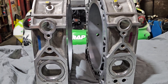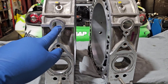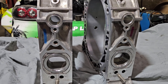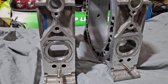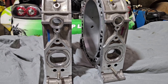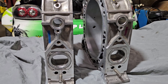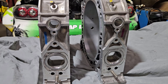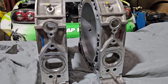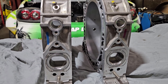It's always important to manage intake flow and exhaust flow — you don't want an imbalance. So we get a nice big exhaust port to match this semi-peripheral, which also does have a small bridge. This is your popular combination right now for 600 to 850 horsepower performance rotary. Or if you're going drag racing or trying to set records, this could easily climb a 13B into 2,000-plus horsepower territory, depending on how it's done. You cannot put a small turbo on this combination — it's too much exhaust back pressure. This is a big turbo combination, and that's why you see the big horsepower numbers.